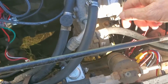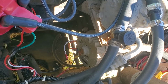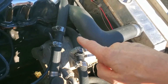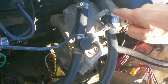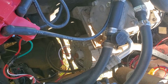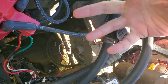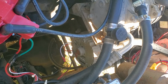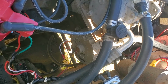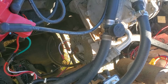So anyway, I think that's all I have to say about that. Oh, if you hear any squealing, it's the alternator belt. This vehicle is one of the hardest alternator belts I've ever had to tighten, and of course that's because I moved the alternator from up here to down there when I added the AC compressor in. You wouldn't think it's hard because it's fairly open. It's not hard to see or get to, but it has to rotate this way, and there really is no way to pry on it. So if you hear it squealing, it's because I ran the battery low cranking it, and the alternator is now working now that it's all hooked back up.